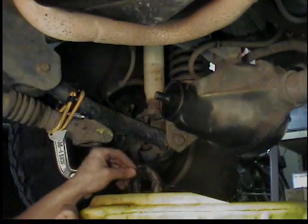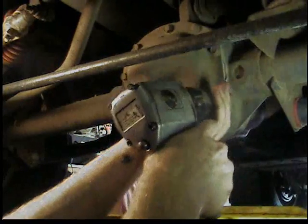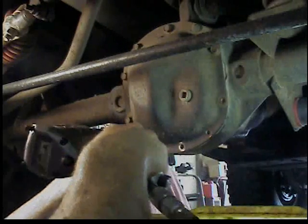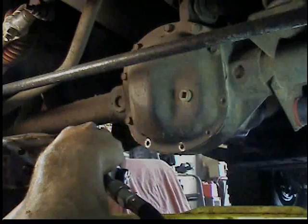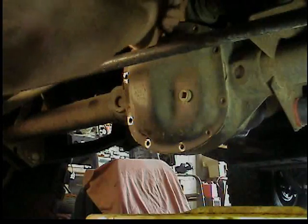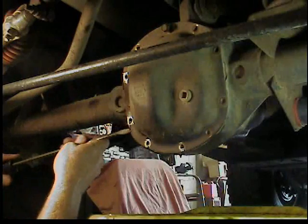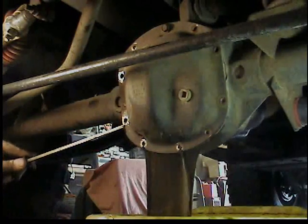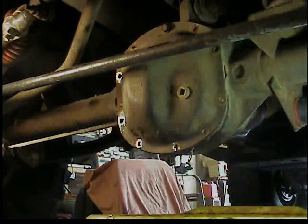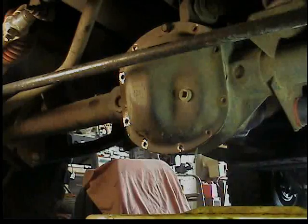Since it's in need of a seal, it's probably in need of a lube change, so I'm going to buzz the cover bolts off the front of the diff and change the fluid while we're at it. Doing this will also help on the other side — keeping it clean, otherwise it'll drip while you're trying to put the new seal in. I'll put one bolt back in loose before prying it open to hold it in place while the fluid drips out. Once it stops dripping, take the cover off and start cleaning it up.